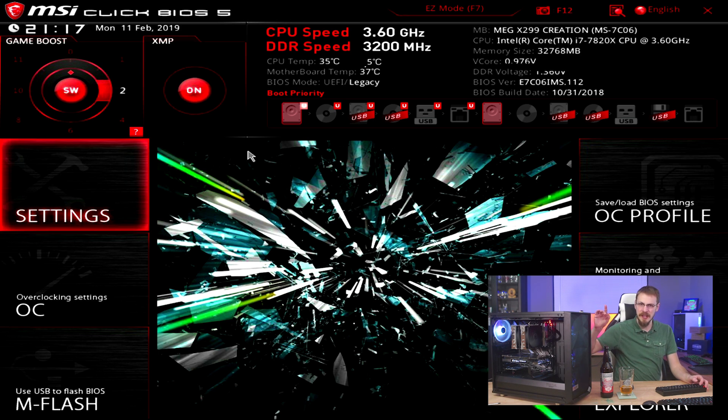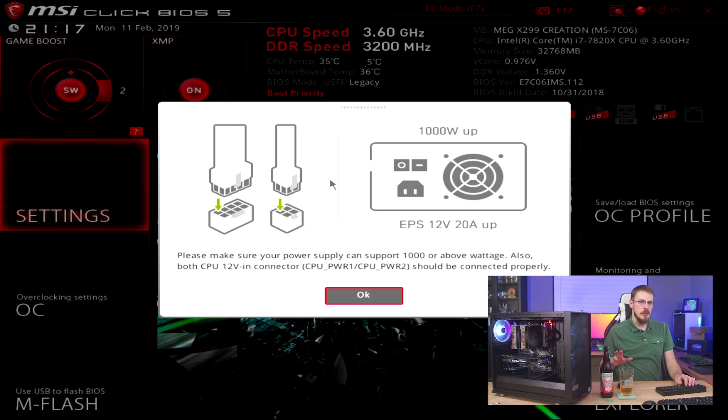I've actually had this chip tested as high as 5.1 gigahertz, so I know it is a very good chip. The reason I'm going with 4.5 is I honestly don't think the Scythe is going to be able to handle this chip overclocked — it handled it at stock speeds, and by okay I mean it was still hitting 90 to 95 degrees pretty regularly, which is way hotter than I like to run my chips. So maybe I'll do an overclocking test on video with this cooler in the next couple of weeks, but for right now we're just going to do a 4.5 overclock. What I love about this board is when I go to save, it says make sure you have at least two of your EPS 12-volt connectors connected and a 1000 watt or higher power supply.